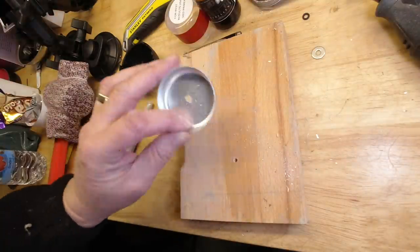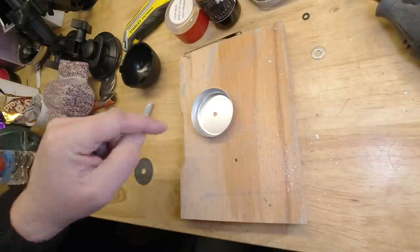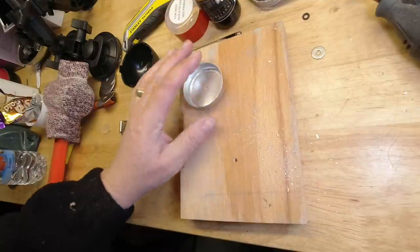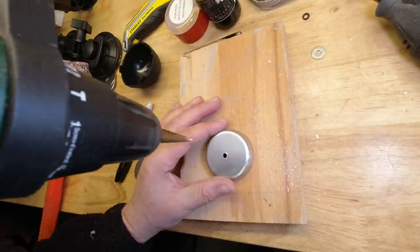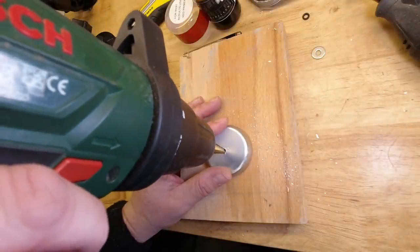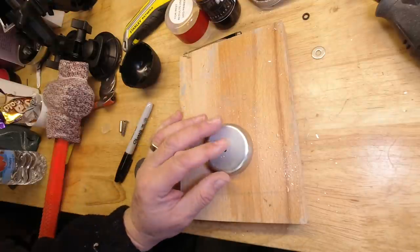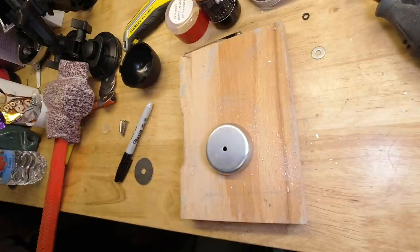And so you're able to drill through quite thin things, because drilling the wood slows the drill going down, and so allows that to go through without snagging. Yeah. If you want to deburr, stick it on the back, gently in contact, really slow rotation. And that's our center hole.